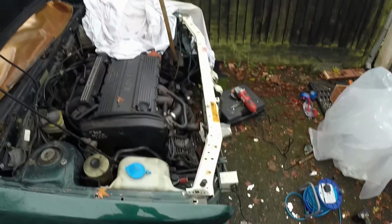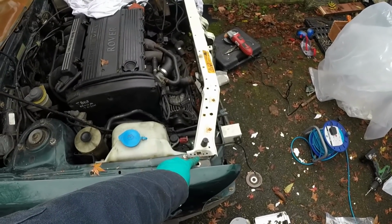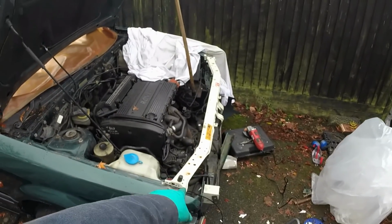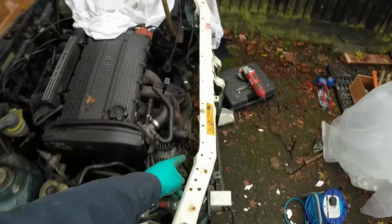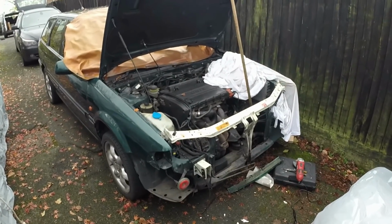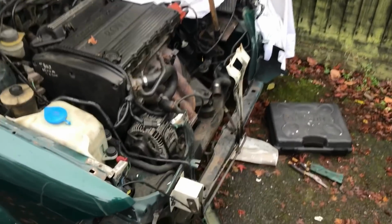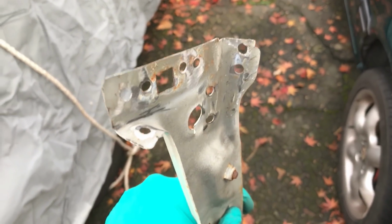Cool. Right, so I will take a hammer and dolly to all of these bits that I've attacked earlier and make sure they're flush. Nip off the final bits of metal left on. Panel beat these bits to meet that bit nicely. And then probably going to have a cup of tea. I've had my lunch break. Just come out with the sanding disc. Just cleaned up these bits, and I have also sanded back any of the sharper bits where the drill's gone through that panel or caused any distortion. So I'm going to do my hammer and dollying now.